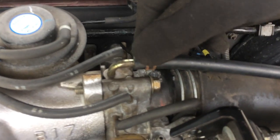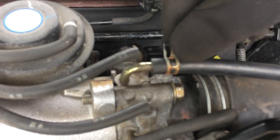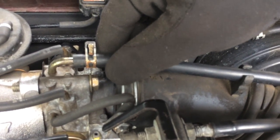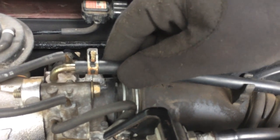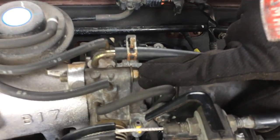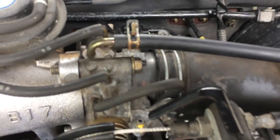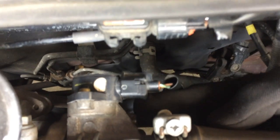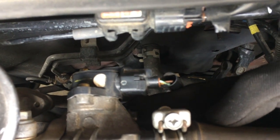Take off this clip, give it a pinch, slide it back, and remove this hose that goes to the evaporative emission system. At that point you'll be able to remove these three 12-millimeter bolts — one here, this one right here, and then there's another one you can't see but it's right below where we removed this connection. You take these three 12-millimeter bolts off and this guy's going to be loosened up.